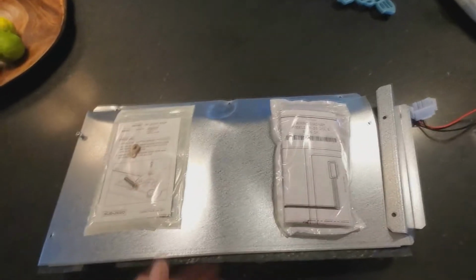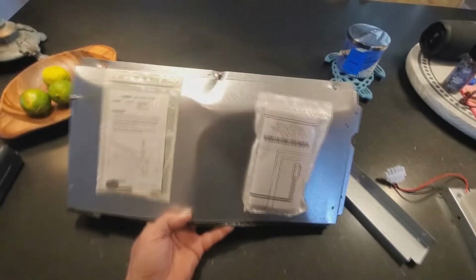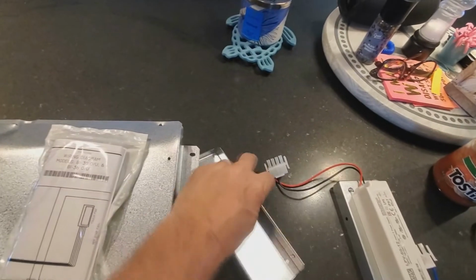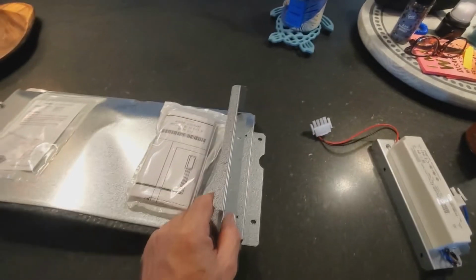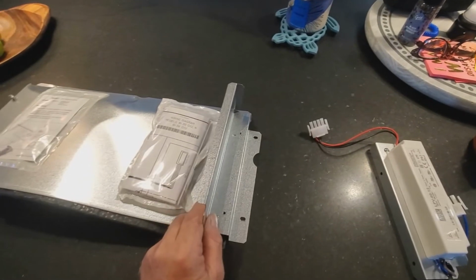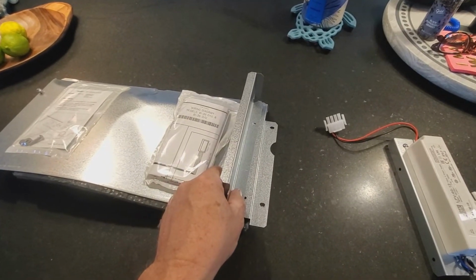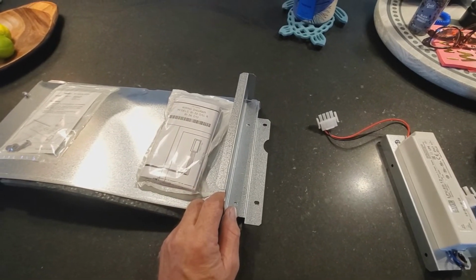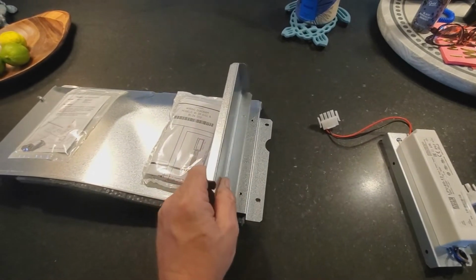Okay, this cover looks like it took a little bit of a beating during the install. But anyway, this is the cover that goes in front of the compressor that I took off, and this is the air diverter right here. It's very important, by the way, on the Subzeros to make sure, if you ever take one apart, whether old or new, whether the condensing unit's on the bottom or the top, you will always see an air diverter on them, and that diverts the warm air coming off the hot side off the coil, so that this thing takes in cool air and exhausts hot air, and that needs to be on there.